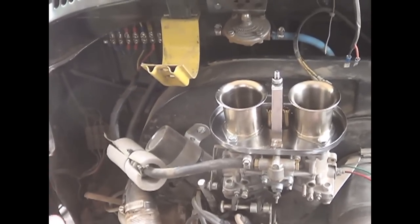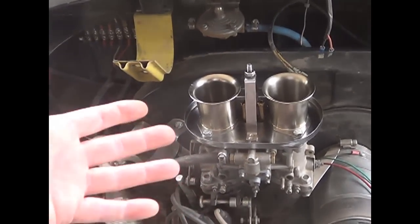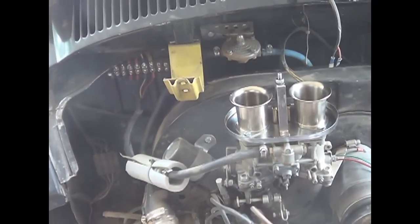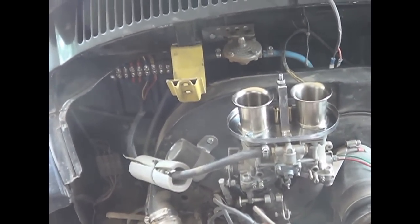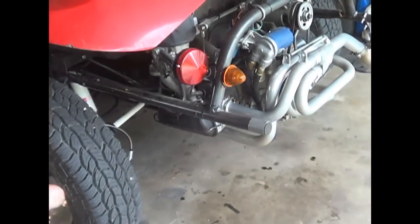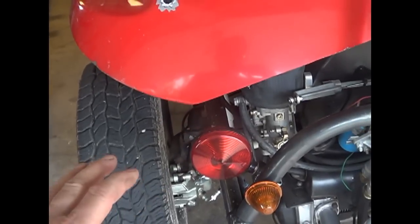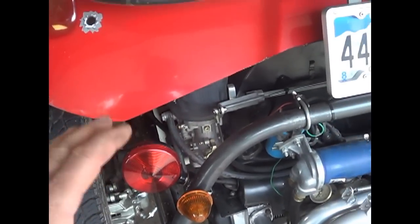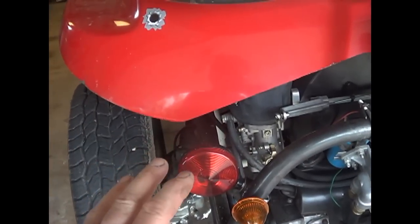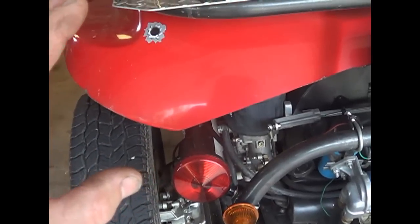It's less maintenance, it's half the maintenance, it's in a better location, it's easier to get to. Right here, it says it all. We want these to work. Does it work as good as duals? No, not in my opinion. If you want the ultimate of performance and smoothness and power and transition and high RPM and low even idle, duals, port on port. I'm not talking Cadrons, I'm talking dual ports. Cadrons are fine, they have their place, but this is the ultimate perfect setup.